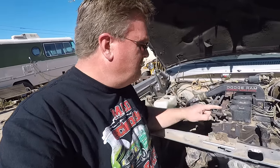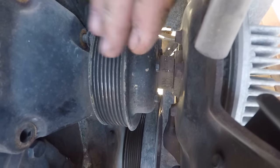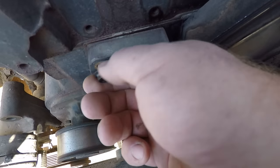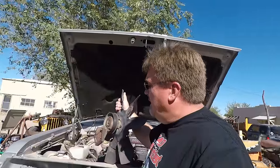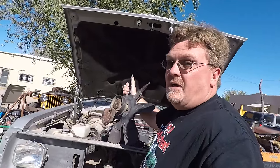Most of this is pretty routine; there's a bunch of videos out there, I'm not going to bore you with that, though I did actually watch some myself. One thing I noticed is removing the fan - here's the fan, there's the pulley. Rather than undoing all the front stuff, you just undo the bolt on the bracket in the back and take the whole bracket off - everything else comes with it. Save a little time by looking ahead.